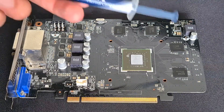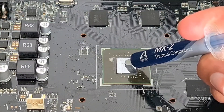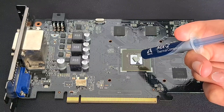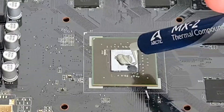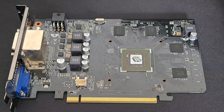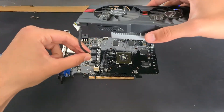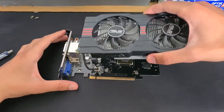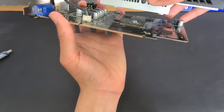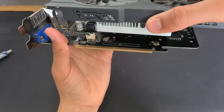When doing this, you can use any thermal paste. I have Arctic MX2 thermal paste. You want to apply a little blob into the center — you can do a line or an X, but this die is very small so you don't really have to do much. Some people recommend that you should spread it all out, but I find that when putting the heat sink back on, it just spreads it out itself. Once you put your thermal paste on, you want to connect the fan header first, then kind of lift it up and sandwich it in between. Make sure you're being very careful not to trap any air bubbles in, and also that the little holes line up.